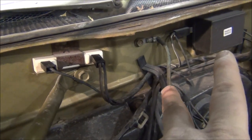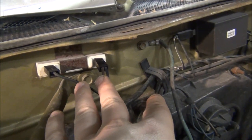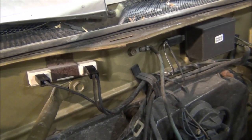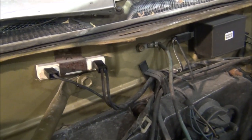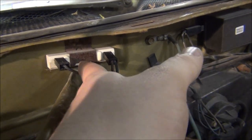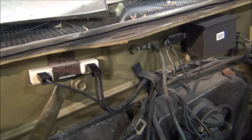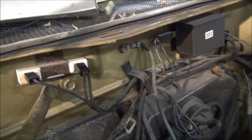There are a couple of extra wires for the electronic ignition with the dual ballast resistor, but the bottom side is hooked up just like this — it's only the top two pins on the double ballast resistor that are different. Basically, we're going to jumper this ballast resistor and put in the new distributor and hook up the wires to the coil. It'll get its ignition feed from that wire. You can find wiring diagrams online; I can't put one up because I don't own a copyrighted diagram, but it's pretty simple.